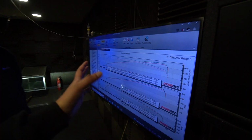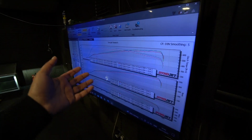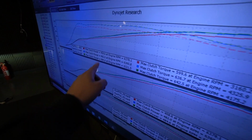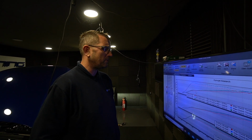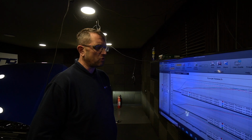Yeah, it's true. I mean, the way it was getting up to 460 in the last video, I was thinking potentially if we had octane booster in there, it might push it up another 15 to 20, but that's done a fair amount there, so 480 comfortably. Would you say that's pretty much at the limit of this turbo now? There's probably a little bit more in it if we use race fuel, but you're maxing out the turbo top end, so you're not going to run any more boost top end.